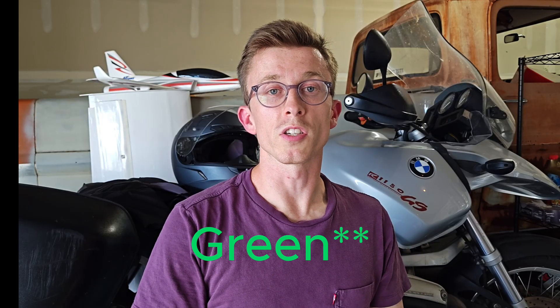With the lightweight design the Ruckus has — weighing about 750 to 800 pounds empty — the Rotax is going to be an awesome powerplant. I opted for the 100-horsepower variant of the Rotax 912. The factory's green demonstrator you've probably seen on social media is flying with the 80-horsepower Rotax 912 UL. I talked to Troy Woodland, the designer of the airplane, and he was a bit jealous — he wishes he had the 100-horsepower engine in their demonstrator because it's going to be a lot of power and thrust on a lightweight airplane, making it really capable for short takeoff and landing.